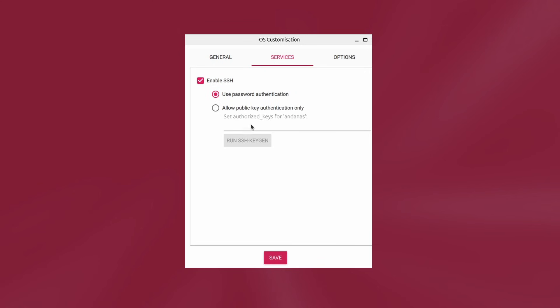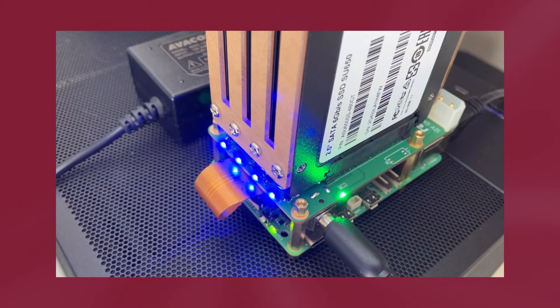You need to install the Raspberry Pi Imager and insert the SD card into your computer. I like to install the Lite version of Raspberry Pi OS 64-bit, because we won't need a graphical user interface. Don't forget to set up SSH during installation, because we'll be installing everything remotely. Once done, put the SD card back into your Raspberry Pi and turn it on. Then run lsblk to see if you can see the disks — but don't worry if you can't; we first have to turn on the PCIe slot.